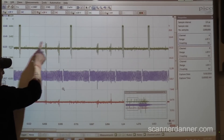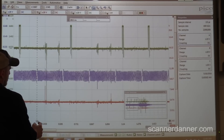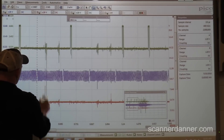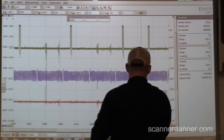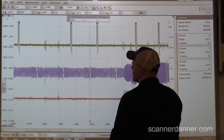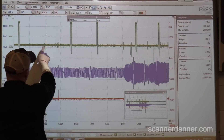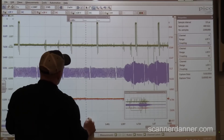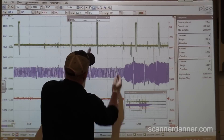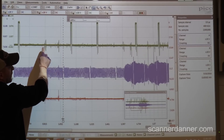Even with consistent uniform cranking, the coil firings should be even and consistent — but they're not. Some of them are missed. Here's my sync notch in the crank. Let's eyeball the spacing from sync notch to sync notch. We're missing one in this area — we lost coil control there. I don't know what caused that, but it looks to me like a cam-crank issue. We're getting bad input so the computer doesn't know what to do.